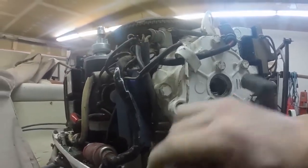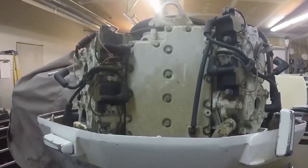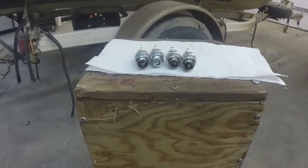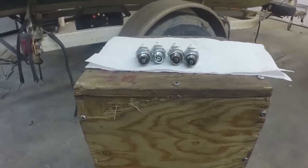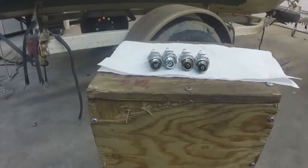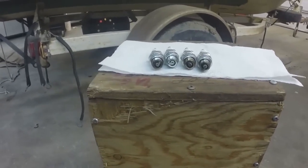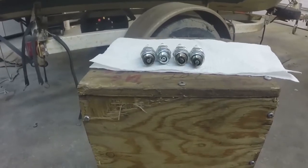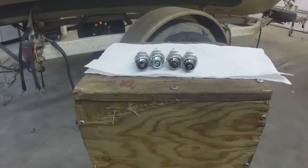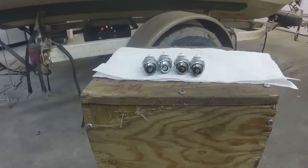He's run new spark plugs, which is fantastic. All right, there they are. We've got one, two, three that look like they're firing in some form or fashion, and that one looks like it's just there for a ride. So we could potentially have an ignition problem, which is just sending fuel directly through that cylinder, not igniting it and sending it out the engine — which would represent that nice clean plug that we see.